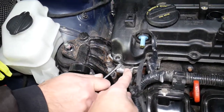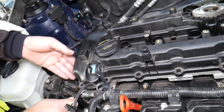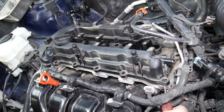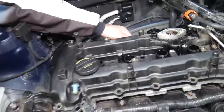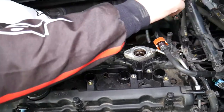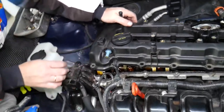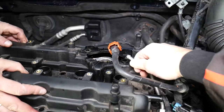There's silicone holding where the timing cover meets the valve cover — on the front and back side — so it will be stuck more than usual. Always work little by little on each corner, not just one side. The gasket is stuck to the cylinder head. The fuel line is a little in the way so pull it slightly to get the valve cover out.